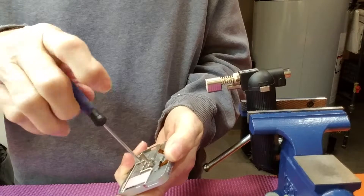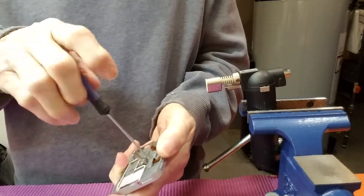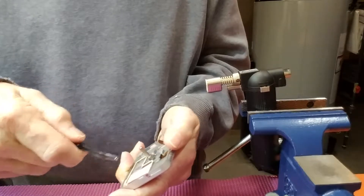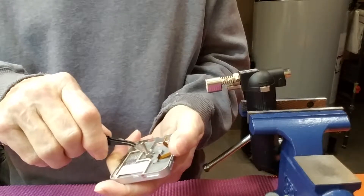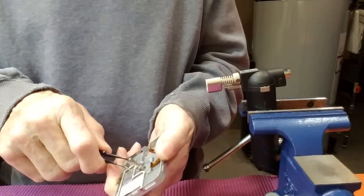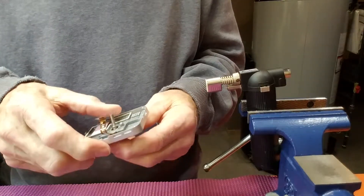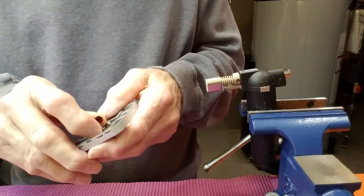We have to take out the yaw motor. As you're taking these three screws out that hold the yaw motor in, most of the time the magnet will grab them on you. In this case it grabbed one. I use tweezers to remove them — the second one, there's the third one. Managed to get the magnet on all three. Now, to get this out of here with the three screws out, you tilt it forward a little bit, lift up on the ribbon cable, and pop it out.